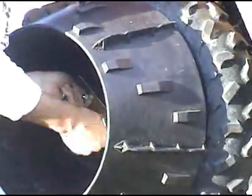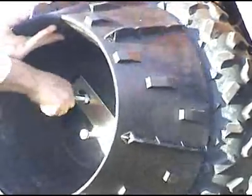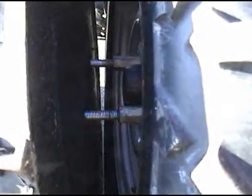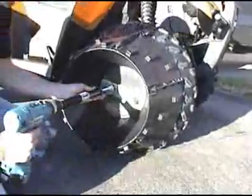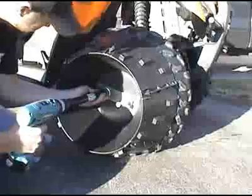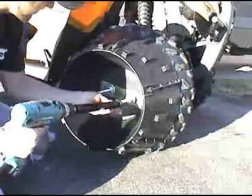If you leave a gap between the wheels and the tire when threading the bolts into the coupler nuts, you'll be able to see what you are doing and the installation will be a little easier. Using a 3/4 inch socket or the wheelz installation tool, first tighten the bolts firmly into the coupler nuts, and then tighten the nuts down against the double washer, holding the wheelz firmly against the tire.